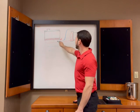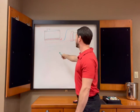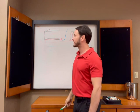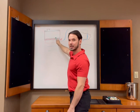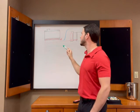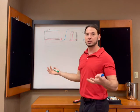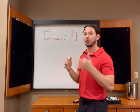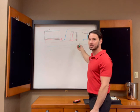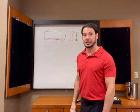And as that's happening, this fluid's getting hotter and hotter. We're starting to get some really extreme heat transfer across there. Engine coolant's getting hot. I see my temperature gauge start creeping up because we're running this transmission so hot that the engine heat, since the engine is working hard too, and the trans heat exceed the heat transfer availability of the radiator and the pan, so we start to overheat it. It's like, man, that's not good, and you're right, it's not.